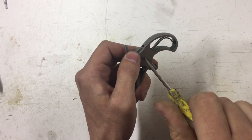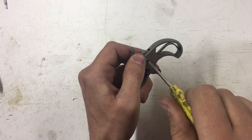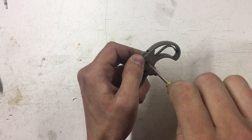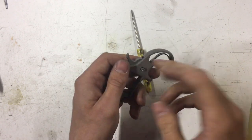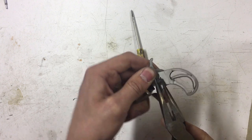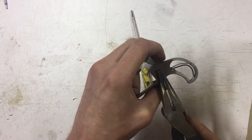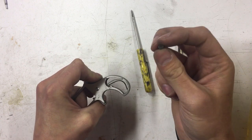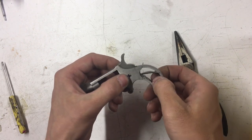This is a reverse thread so you have to make sure you crank it clockwise — if you go counterclockwise you're just going to get it tighter. Being real careful not to put any digs in the middle. I've got it loose and there's spring tension on it, so very carefully I'm going to grab it with some needle nose, press the hammer down in this direction, and that's going to pop right out.